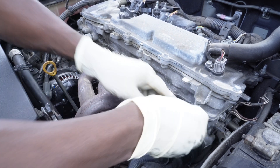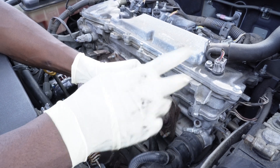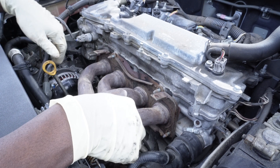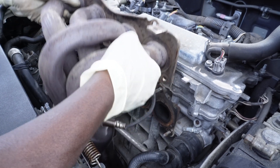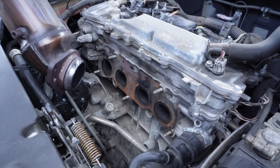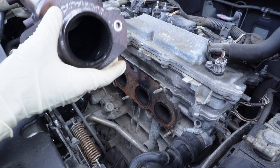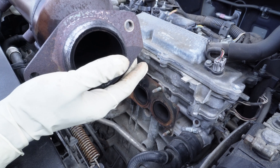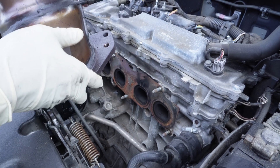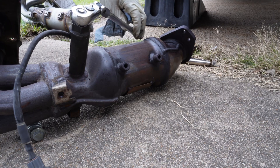I disconnected the oxygen sensor — it's only one oxygen sensor connected to this exhaust, and the other one is downstream. So I can pull this out of position and this is our cat — this is our guy. This looks good inside; I don't know if you guys can see it, but this cat looks good and pretty neat. We'll replace it and then look at the diagnostic data again.